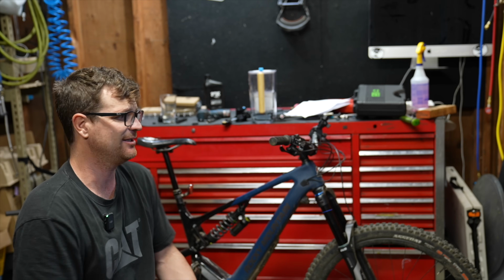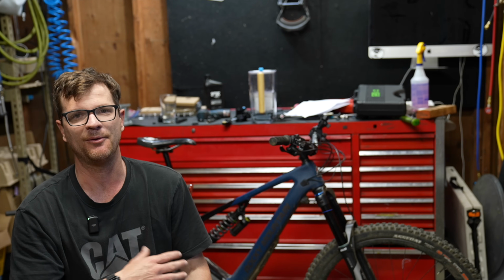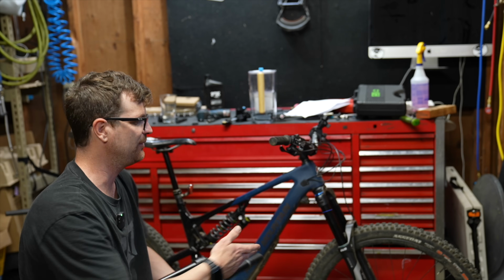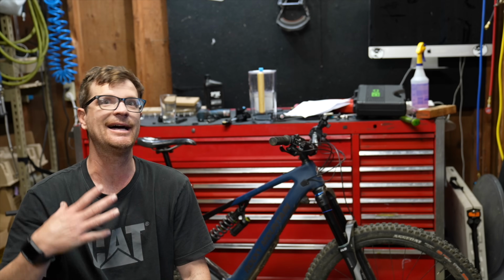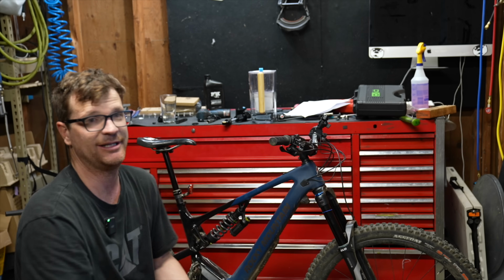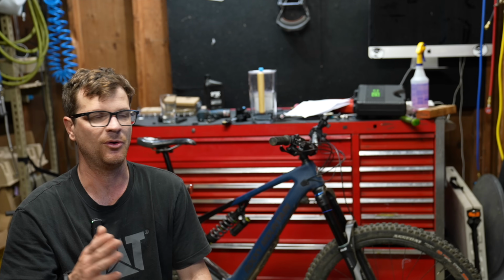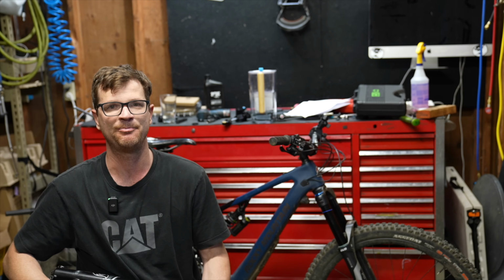It's just the blue flow trails. It's a little bit sluggish. They got the rebound way too slow. I'm 100 kilograms, 220 pounds. I need to pull a couple shims out of the rebound side to make that to my liking, but the compromise is it's amazing in the chunky trails. More control. If you're a lightweight rider, you would probably struggle with that rebound tune.